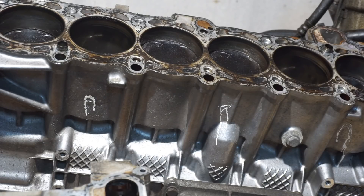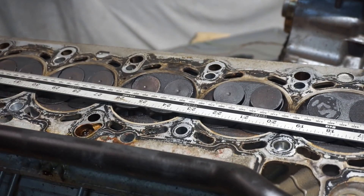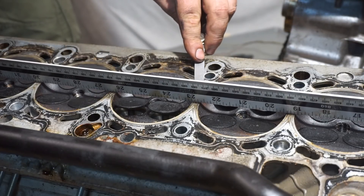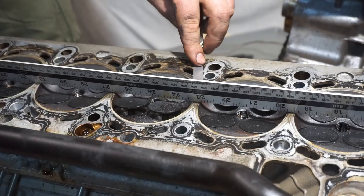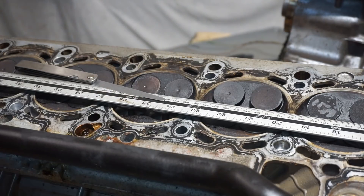That's another indication — and this is how great it is to do a leak down test before you start a project and buy parts. I now know what I'm going to do next instead of investing money blindly. I still have a used cylinder head over there from a 3.8, which is exactly the same with only small differences I explained before on my channel. On the other head I can squeeze in 0.05mm here versus 0.2mm — four times more warpage on this one.